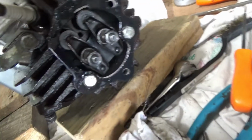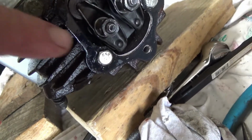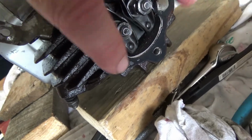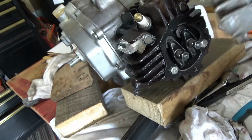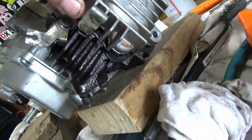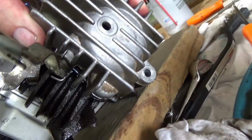A valve cover gasket, smothered with a little bit of oil on each side, so maybe when I pull it off, it isn't going to stick. And these holes here are pretty tight over those hex nuts. I'm guessing there was some round head something, or just a little bit smaller, because these I don't think were original. But anyway, it did fit on there, so I'm just going to go ahead and put this on. The decompression thing comes this side. There's one right somehow or another. Like so. And 2 bolts.